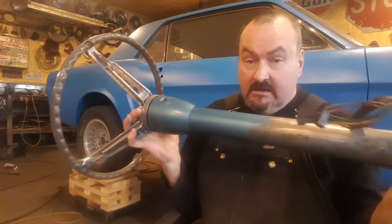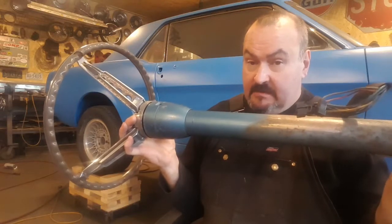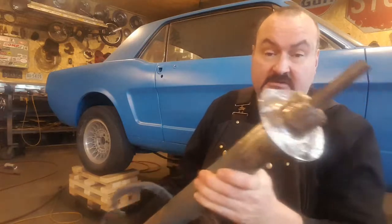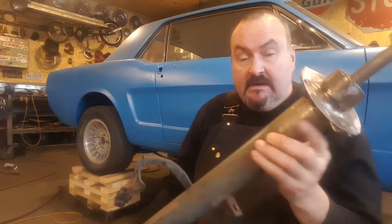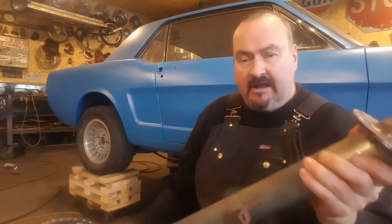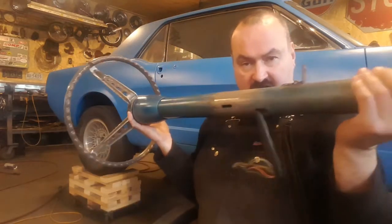Fitzy back at you here. I'm here today to show you how I modified the 66 Mustang column to get it set up to take a rack and pinion steering. Now, if you're familiar with these, they have the box mounted to the bottom side of the column. When you cut them off, there's no bearings, no way there to hold it all in place. You can actually take the column right out of the car. So you've got to find a way to secure the shaft inside the column.